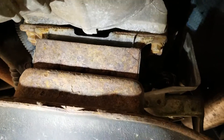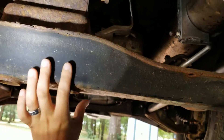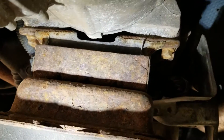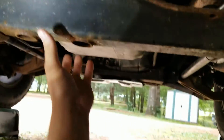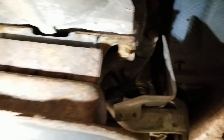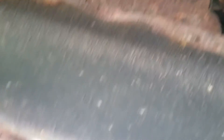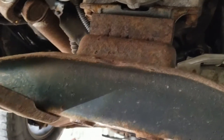Here's the transmission mount right here — it's right at the back of the transmission. There's the pan for the oil. There's one crossmember right here, and the mount is right here. It just looks rusty; that's the only reason why I'm replacing it. Looks like some of the rubber is starting to flake off. More so, like I said, I just want to take this crossmember out, clean it all up, and see how well it does with painting. You've got one bolt there, one bolt there on the transmission themselves, then one bolt here and one bolt there that mounts the mount to this crossmember.